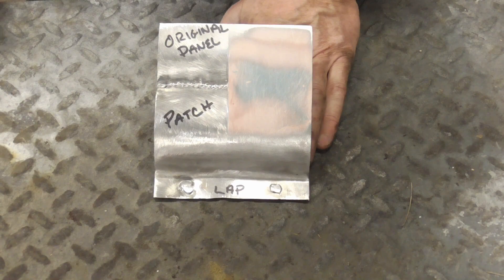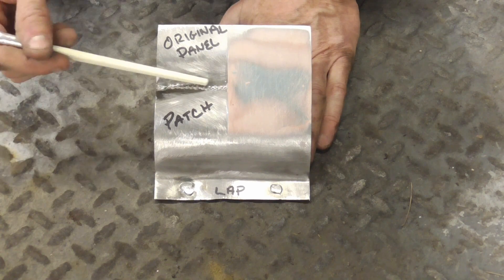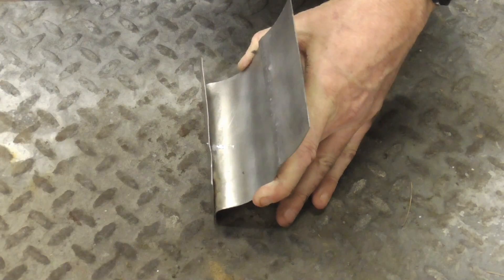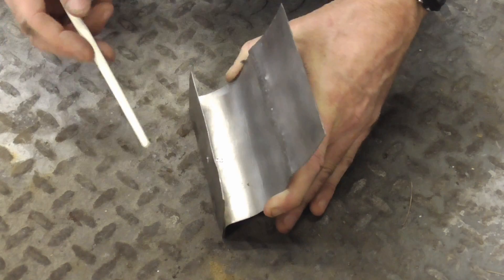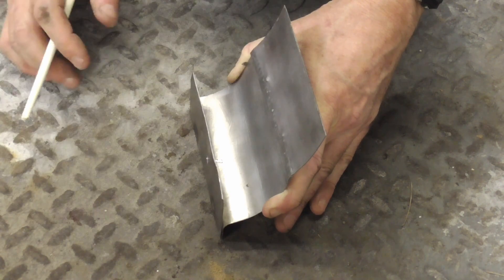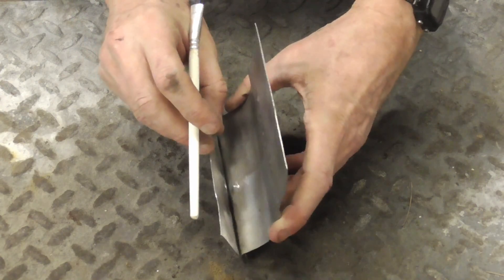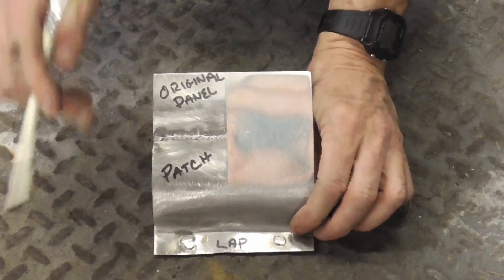The next example is a patch using a lap weld. The patch was laid over the original panel about a quarter inch, lap welded solid, and again I cannot guarantee that this is waterproof. The seam was tapped down and filled; the bottom was lapped and spot welded on the inside. On the inside, the water runs down and settles at the bottom — hopefully there's a drain hole drilled so it can drain and dry. The seam is upside down on the inside and will not hold water. If there are any imperfections in the welds, you have a rigid layer of waterproof fiberglass-reinforced filler to protect the finish. My guess is it's going to rust at the bottom where the salt water settles before there are any issues up at the seam.